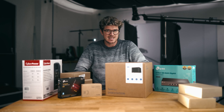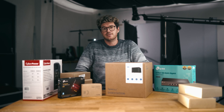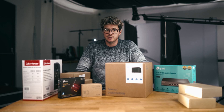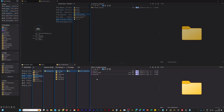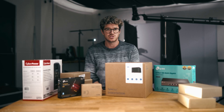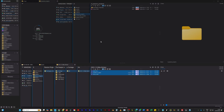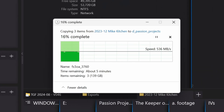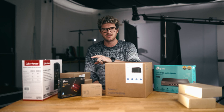On paper the read and write speeds are fantastic, but rather than throwing benchmark values at you, it makes more sense to show a practical example of copying large video files to and from the NAS, since that's more in line with how I'll be using it. I took a folder with three large video files — a 3-cam interview from a documentary I'm working on, total size 178 gigabytes. I copied that to the NAS from my workstation's SSD, and it transferred roughly 535 megabytes per second, so that's 178 gigabytes transferred in about five minutes.